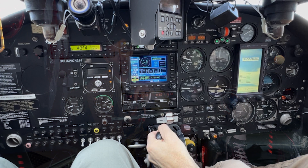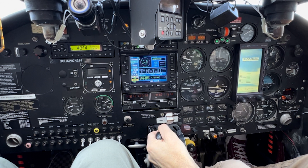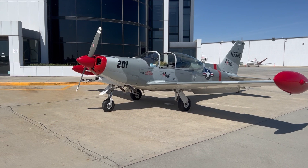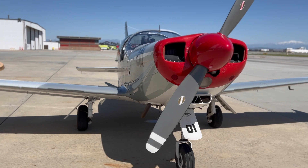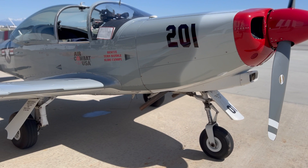The fuel selector is right below the throttle quadrant — super important. That's the primary reason the PIC flies from the right. All the instrument stack is also on the right in the 1988 Marchetti SF-260 you'll see in this video: an Aspen attitude indicator and HSI on the right for the PIC, a 530W on the left as the primary nav display, a KX-155 secondary radio, and an intercom on top. The gear handle is straight below the eyebrow — I reach up for it with the left hand after takeoff. The flap control is nearby, shaped like a flap.